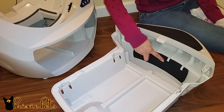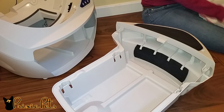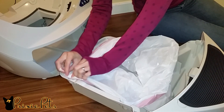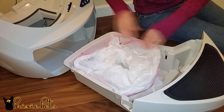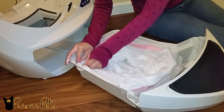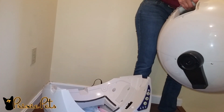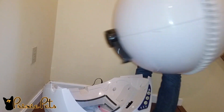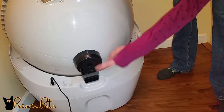The first step in assembling the unit back together is putting the filter into the tray. Make sure the top of the filter is under the clips. Put the step mat back into place. Next, put a fresh bag in. You can now return the tray into the base. When putting the globe back on the base, put it on in the home position and onto the tracks. The key on the back of the Litter Robot 3 needs to be in line with the notch in the back of the base.